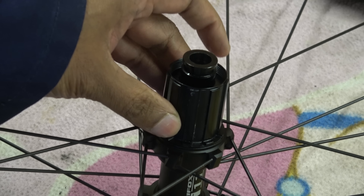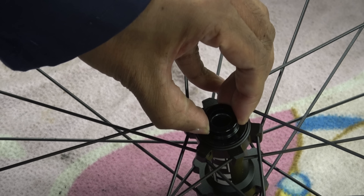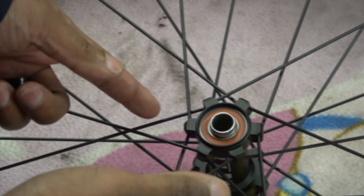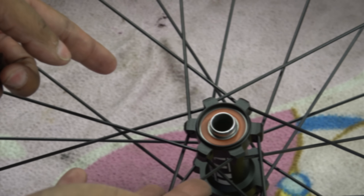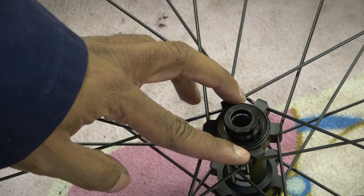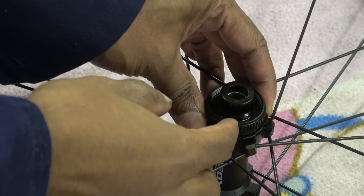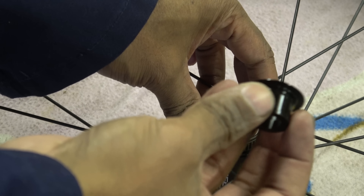The freehub itself has the usual sort of small cut marks in the side where the cassette's gouged it a little bit. This is the front hub and whoever designed this hasn't messed around — 12mm through axle through there. And again, another NTN 6902 bearing on that side. This is cross-laced and it really has to be because it's got the braking force of the front wheel on. When I was riding this, it's not a very stiff wheel — even the rim brake wheels with carbon spokes are much stiffer than this. The cap seal around the edge is effectively a tertiary seal because the primary seal is on the bearing inside. On this side, the bearing placement is as far out as they could reasonably get it. Got an O-ring along the side of there to hold it in.